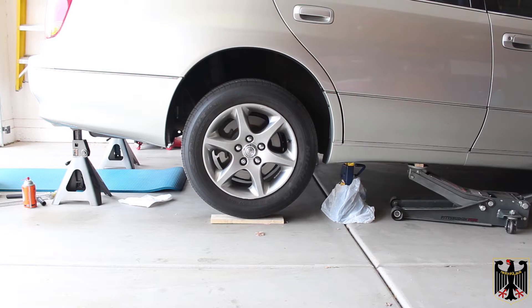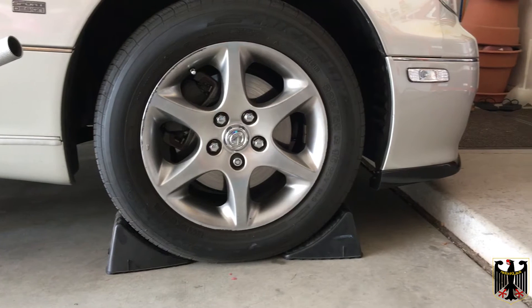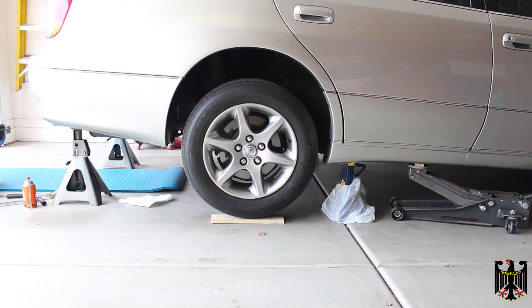Before we get started working underneath the car we want to make sure it's perfectly safe. We put some wheel chocks in front of the front wheels, both sides — four chocks total. We put it on four jack stands, two near the rear just in front of the rear tires and also in the rear just where the exhaust comes out. We actually have it supported on four jack stands, and then we put a piece of wood under each wheel just in case the car was to fall, and then one additional floor jack just to make sure we are super safe.